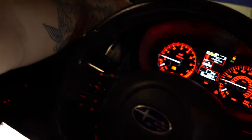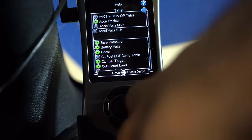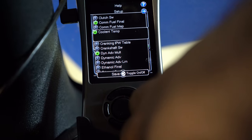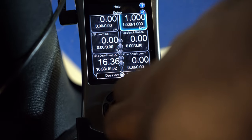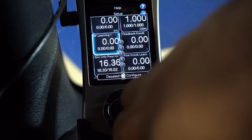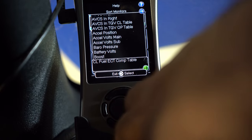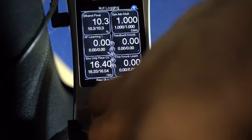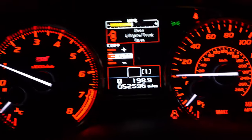This AccessPort accepts flex fuel and works with the inline Visconti wideband. Currently I am flashing it. Once this is all done, I'll change the data log so my tuner can see it. We're going to set it to ethanol final, and get rid of the boost channel since we don't really need that. We'll do ethanol final — and there we go, it's reading correctly.